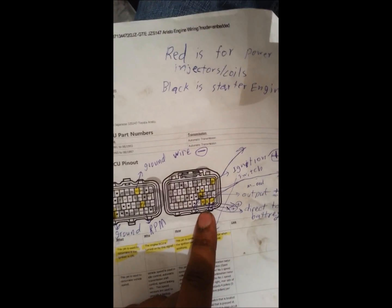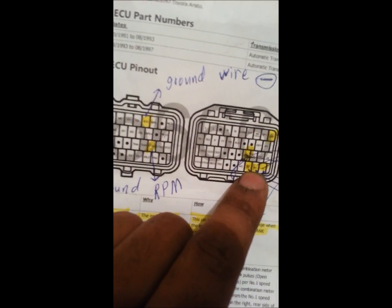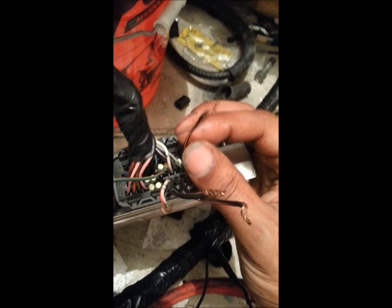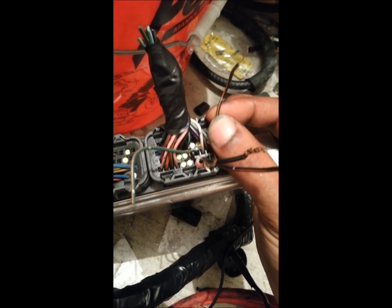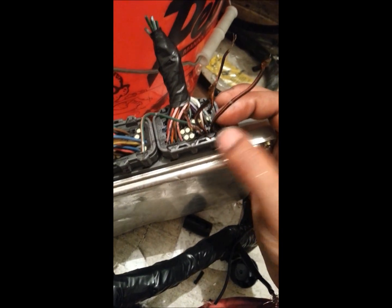On the ECU, look at the far right plug — the top one on the right is the ignition wire, and here it says plus B and plus B1 battery. The top right is the switch wire. The plus B wire is at the bottom further on the right.